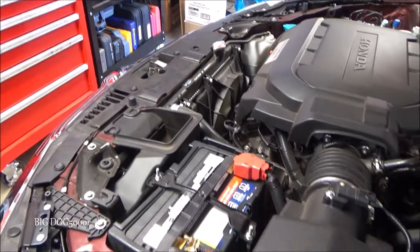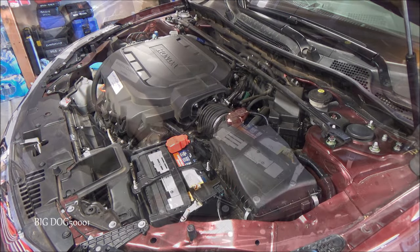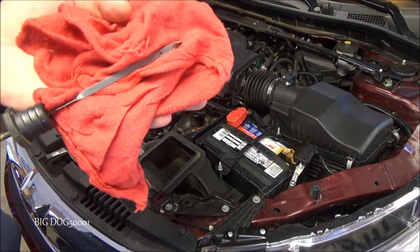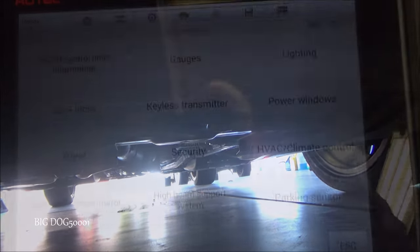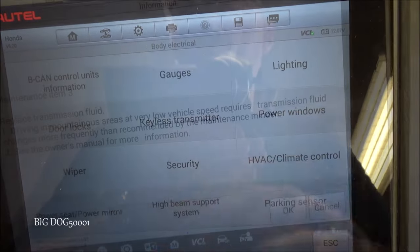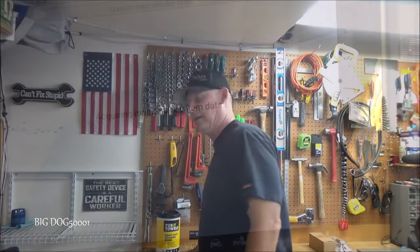The fans finally came on — I shut it off, so we'll wait 60 to 90 seconds and check it. As long as it's between the two dots, we're good. Of course, check for leaks and make sure everything looks good. We'll reset the maintenance minder inside the body control module. And that's how you service the transmission on these newer Accord V6s. If the video helped you out, give it a thumbs up — thanks for watching.